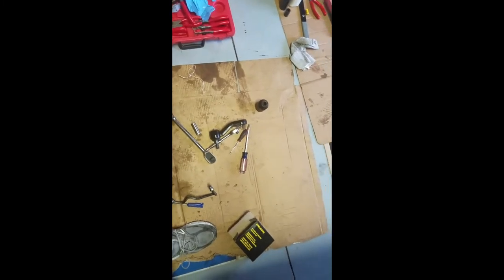Cram this back in the hole. Still working, it didn't get dark out yet. I almost forgot about this — the Pitman arm itself is not too bad, but the tapered stud was spinning. I just spun the stud longer than I'd like to, and I totally forgot. What happens is you put the taper in over here and start using tools and turning it — keeps turning, but you're not tightening it because it's spinning in there. Luckily some OEM ones have a thing you can grab. I put a little 3/8 impact on it, buzzing for like 30 seconds. It probably wore a mark into that hole. Remember that biting me in the ass years ago — a tapered stud in a hole sometimes just doesn't work. You gotta hold it and crank it with a wrench.